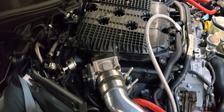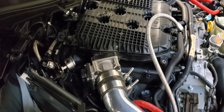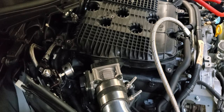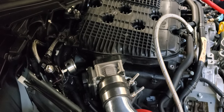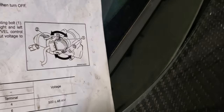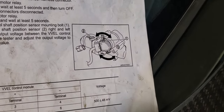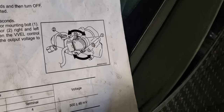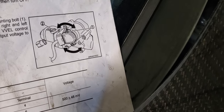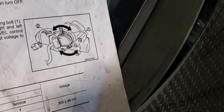Key on the car, and at that point you can look at the VVEL sensor range and begin to clock them back and forth — just like the illustration — until you can get it within range. You need to get it to 0.50; I get all of mine at literally 0.50.